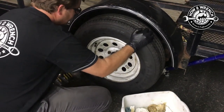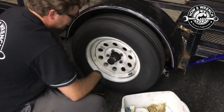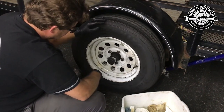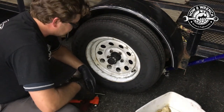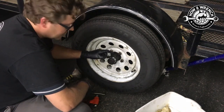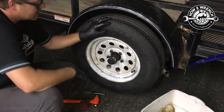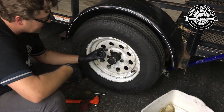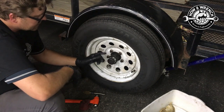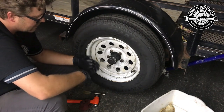Alright, let's check our work. Yeah, it feels good — no spots in the bearing, no issues. This is a good time to re-torque your lug nuts too if your tire was used. There's your tip from howtowrench.com on how to service and adjust the bearings on most pull trailers — they have these tapered Timken-style bearings. These do wear over time, so this is normal to get that little bit of play. That's why you either have a service shop check them out, or you check them out yourself.